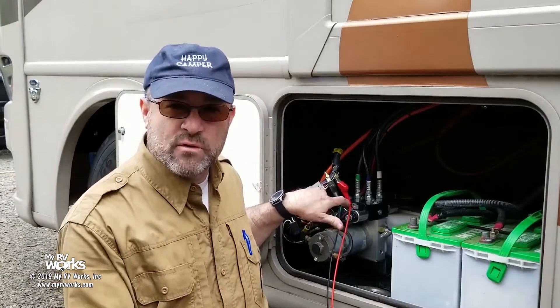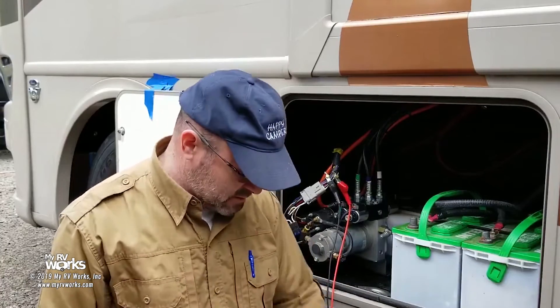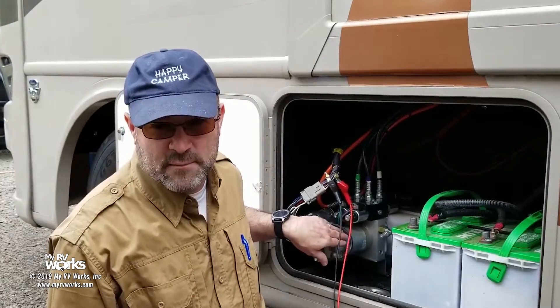So what we did was follow the trail of 12 volts in troubleshooting this system. I hope that was helpful to you. It could have been the control module — we would have found 12 volts going to it but nothing sending back out. It could have been the solenoid, but power was passing through it. By following this trail we've eliminated quite a few things, made our little map of color codes, and at the end of the day it turned out to be the motor that runs the pump. If this was helpful, thumb it up, subscribe to our channel, share it with your friends, and remember happy campers say 'My RV Works.' This is Darren from Silverdale, Washington, signing off — see you down the trail.